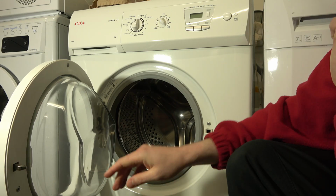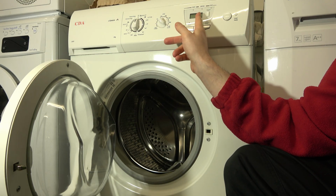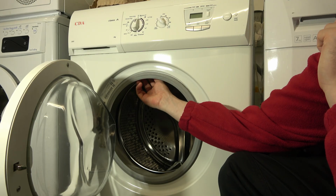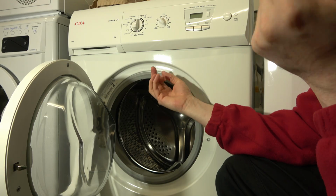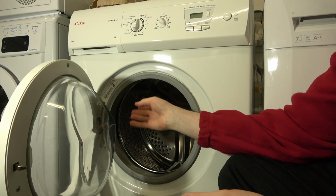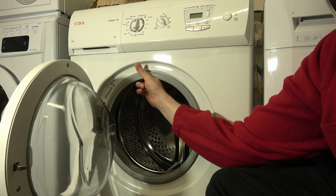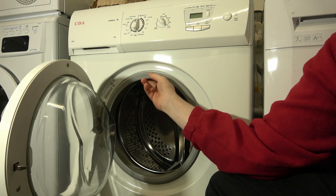Also, and I noticed it during drying, it's rather bizarre, but there's moisture getting into this control panel here. I'm not really that surprised. Again, build quality. So the door seal obviously goes around the dry duct, except there's a gap. It's not very tight. Like, come on. It goes round it, it's just not tight. The door seal isn't coming down, weirdly, but there's still a gap. It's really not like a hole, just a plain gap. Really bizarre.